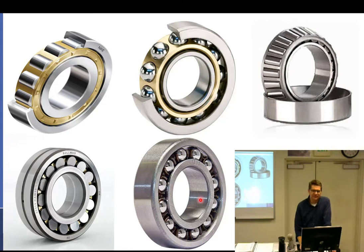Wheel bearings are different — you've got to clean them and grease them. You blow them dry. You never spin them on your fingers because they can actually explode. You're supposed to clean them with solvent, blow them dry, and inspect the inner race and all of the rollers using a 10-power magnifying glass and a light.